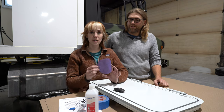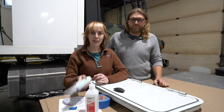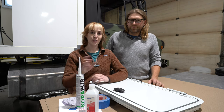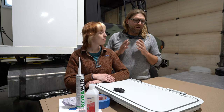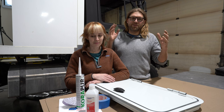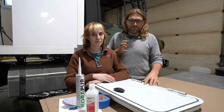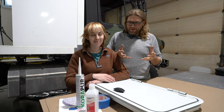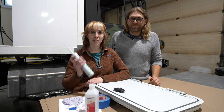All we're gonna do here is sand the composite box as well as this flange here, set it in place, tape it off, and then it'll be time to put the adhesive onto this lip and put it into its final resting place. Important step here is you're gonna probably wanna put some gloves on. You don't wanna get adhesive all over your hands. Tricky part is getting everything set in and not getting adhesive on the gloves and then touching things. Should be a little easier with the hatches since they're small and they're not heavy. The door is tricky. You're trying to hold it, but there's really nowhere to hold it. But yeah, make sure you get your gloves and just be careful to not make a mess. Mostly we're gonna try to not make a mess with all of this glue.